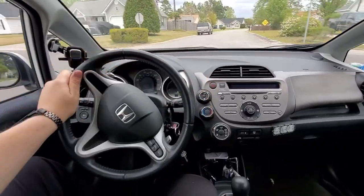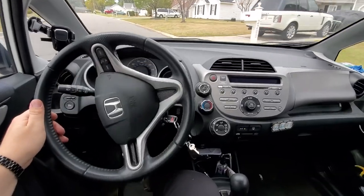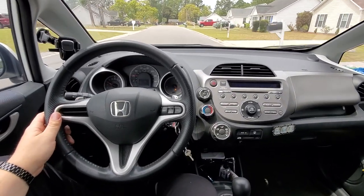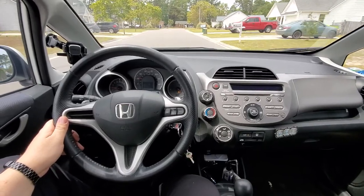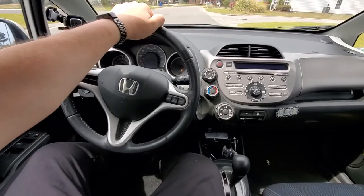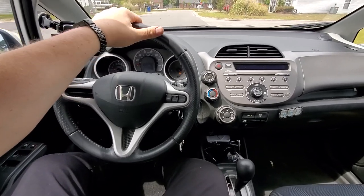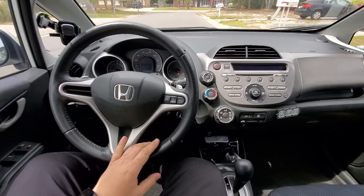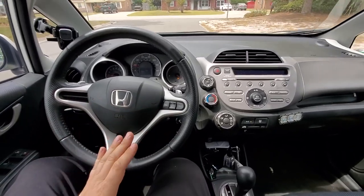Guys, after you complete the brake master cylinder replacement and bleeding, I highly recommend you test out your ABS system. Just do a really heavy brake, and it actually works really great. The ABS works just fine, everything is working. Every time I press the brake pedal, it holds and does not sink in.